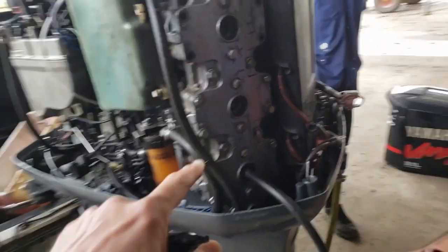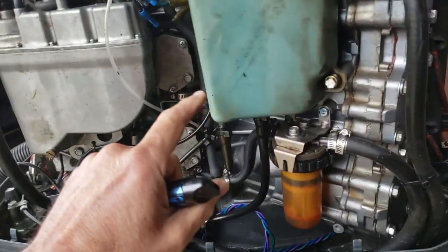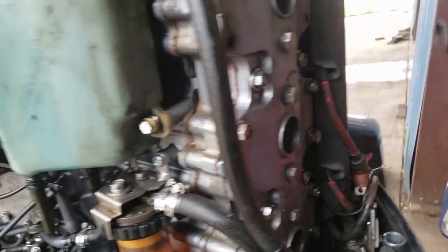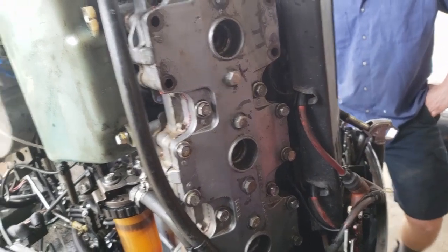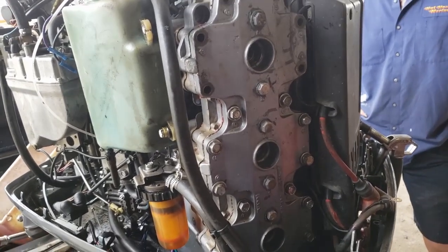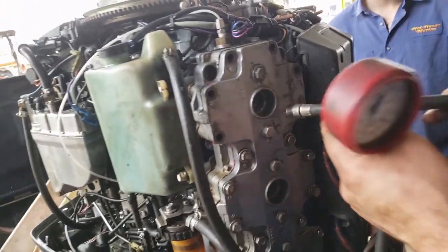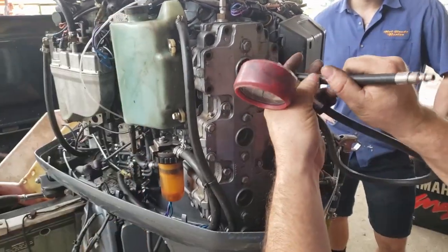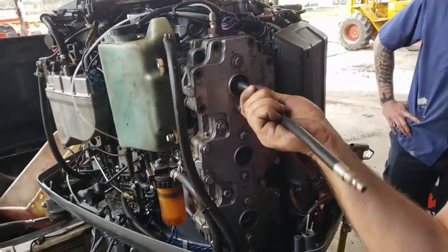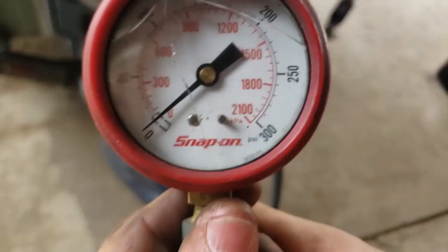The center cylinder reading a little high might mean it's a little wet in there. Our fuel pumps are over here, so maybe it's drawing a little fuel off of there — or maybe when they rebuilt it they did a better job on that bore and the rings seated better. For kicks, we'll go ahead and screw the gauge into cylinder two. We know it's zero, and with the head bolts missing any pressure could just push up the side of the head gasket anyway — the rings are shot on top.